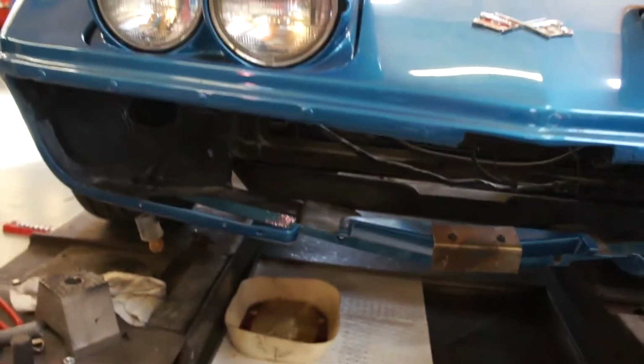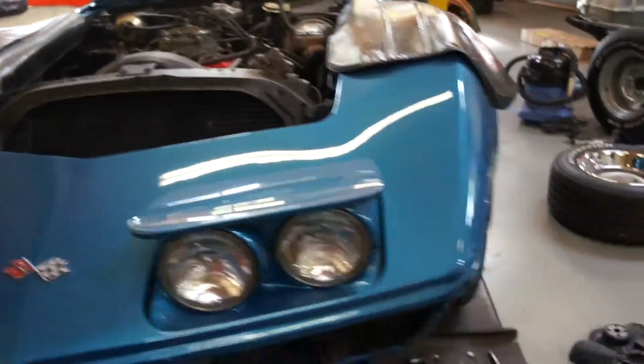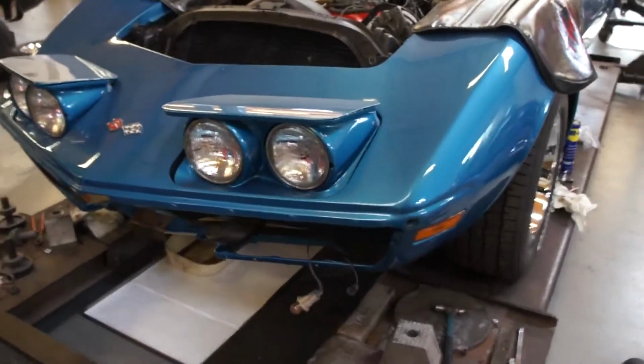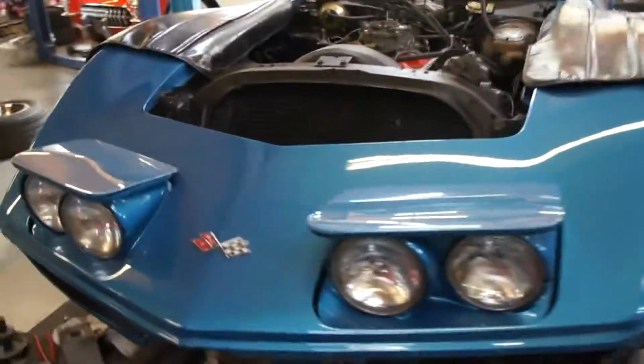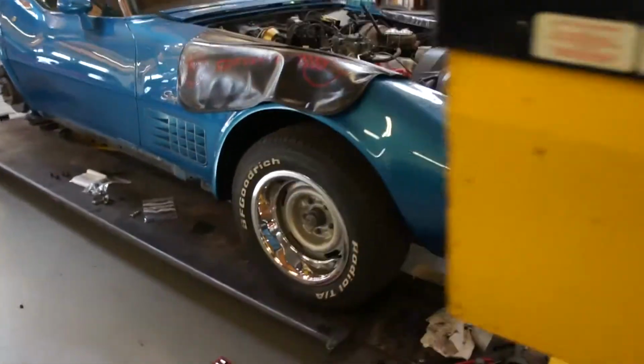The other problem we've got is that when you look up here, the headlight frames have got a little extender between the front end metalwork and the headlight frame itself, and I think that maybe later headlight frames have been used which are shorter here, because the later cars have that cut out by the bumper, and I think they've been extended to accommodate that, which is not ideal, but it is what it is, and I think you probably live with them again. I don't know that you go to the expense of changing headlight frames just to put that right. See how you feel.